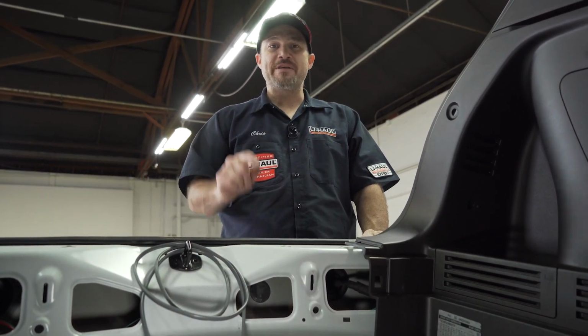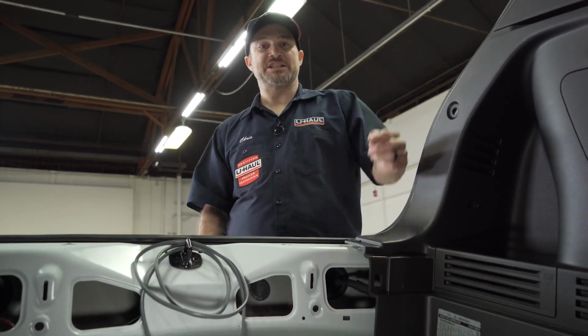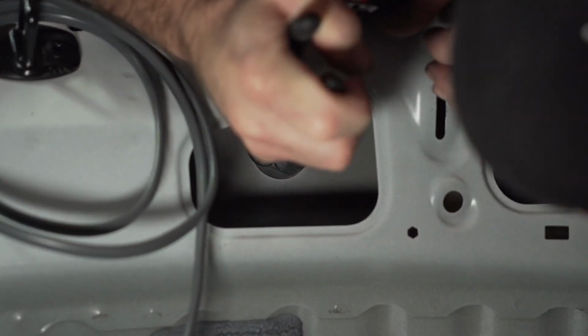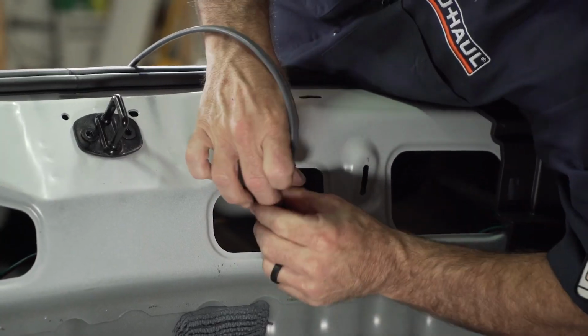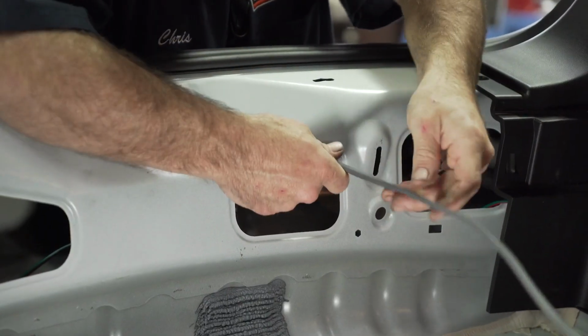We're also going to use that fish wire to fish down the 4-flat connector by accessing a grommet down here. You can use a pair of needle nose pliers to pull on it. It's in there pretty secure. Now use a length of wire to pass it through the hole and down and out the bumper. Tape your wire to it, pull it back up.